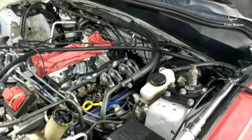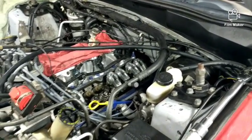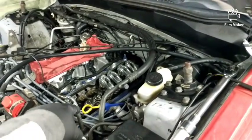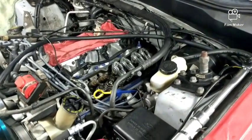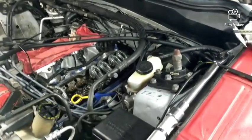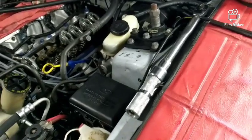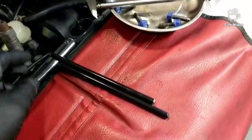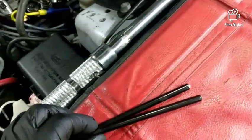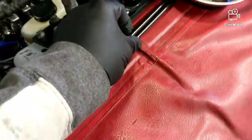Got to thinking and reading some other stuff, and it says stock pushrods — especially with these springs that are not super strong, I think they're like 380 — at the higher revs the stock pushrods might be starting to get a little wobbly. I thought, you know what, I got a set of Trick Flows, they're 6.25 or supposed to be, and I'll just stick them in while I got the upper off.